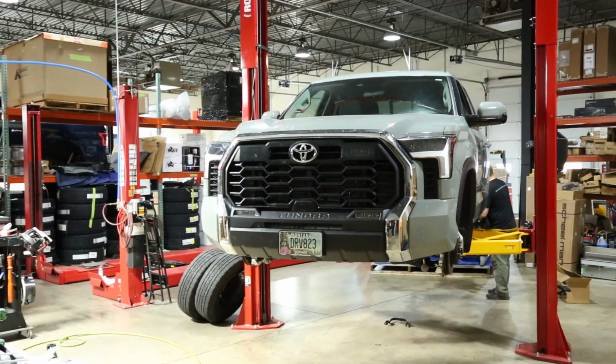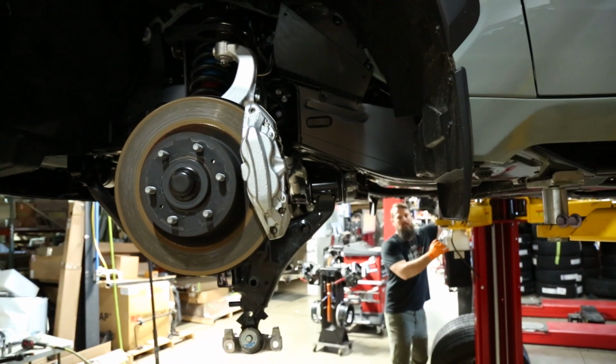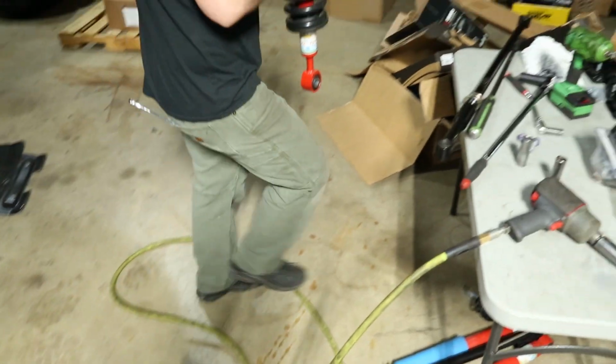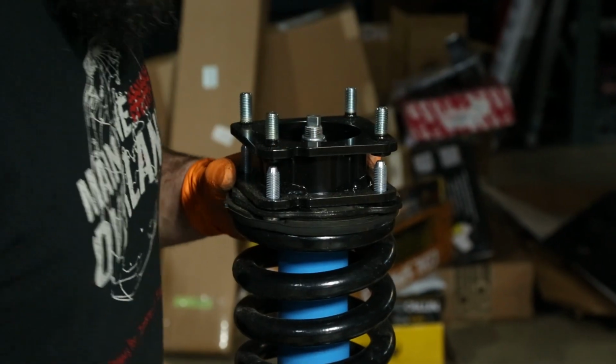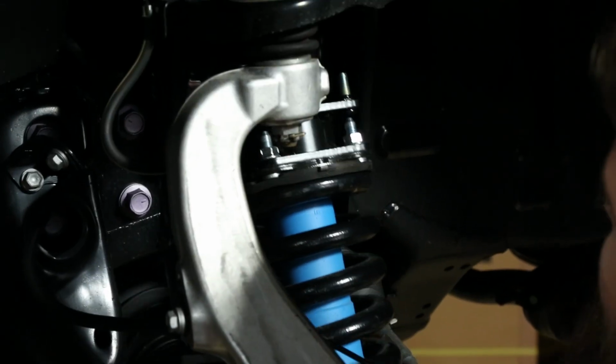With the rear suspension now dialed in, lack of parts availability for this new platform had us searching for a proper front suspension solution. They were looking for something that was going to be easily serviced, not require rebuilds, a remove and replace component with an OEM lifespan when the time came. That product did not exist during this build, so we accommodated a front end lift with a spacer at this time.